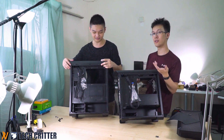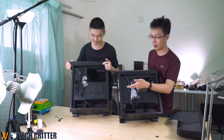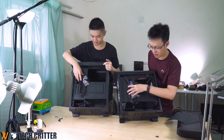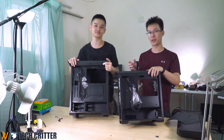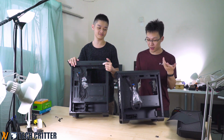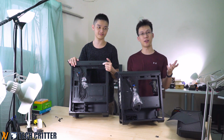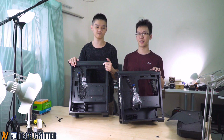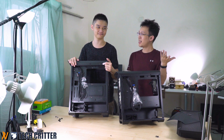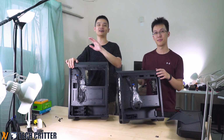Well, yeah, that's why you need to find the right cable for this kind of installation, because especially for the Alpha M as well, these 2 SSD installation slots over here require you to look for straight SATA power connectors, as well as the SATA data connector. Something you need to think of, but consider that nowadays the M.2 SSD is getting way more popular and affordable, so I guess that is not really a problem right now. And using M.2 means that you don't have to worry about cables at all.